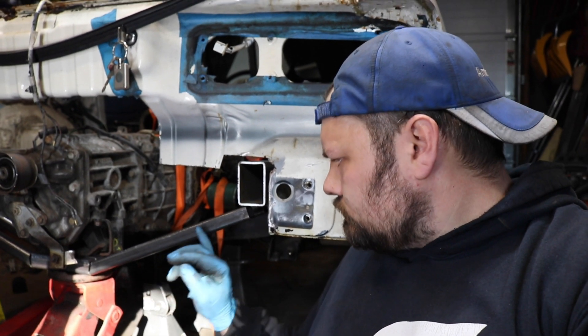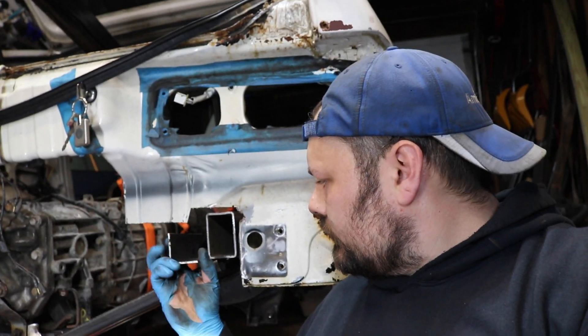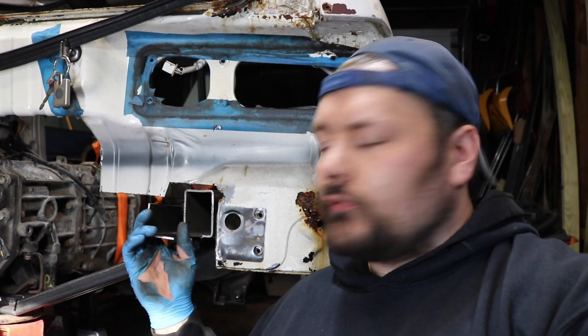The way these are right now, I'm going to cut these and then get them to go farther up — probably have to cut the relief a little bit deeper — but use some 2-inch L-channel, basically weld these bars to the sides of the bracket and then this will sit against the frame rail with bolts going up through. Unfortunately, that's the only piece of L-channel I have that's big enough, and it's not long enough, so I'll have to go out and get some. I need to get the tubing for the front of the cart anyway, so it's not that big a deal. On that note, I'm gonna end it here. Thank you so much for sticking around, I really do appreciate it. Just remember, when stuff like this sometimes all you need is a little bit of ingenuity. I will see you next time.